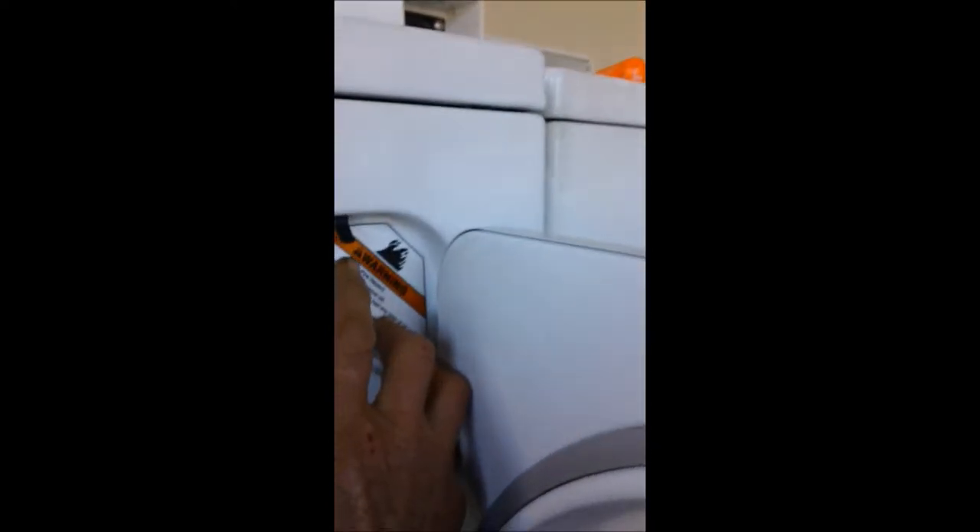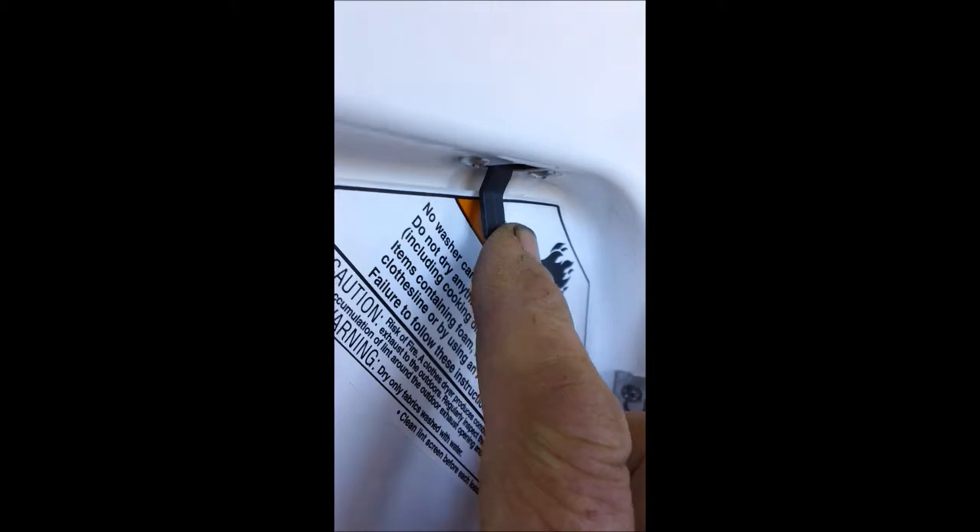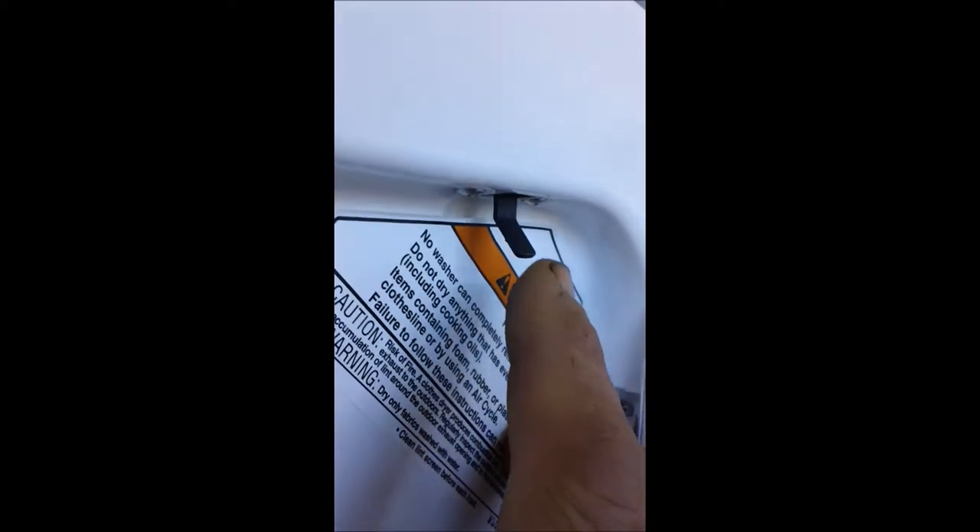What we're going to do is show you a little trick to see if your dryer is working. If you look down here, you'll see the little viewport. Once you turn it on, you should be able to look inside there and first see the igniter glow for about 10 to 15 seconds, and then you'll see the flame ignite. We also want to check the action on the door switch — you should hear it click, and the door switch should spring back. That would indicate the door switch is good.